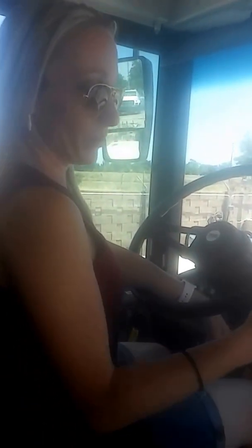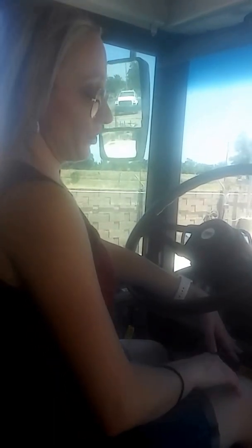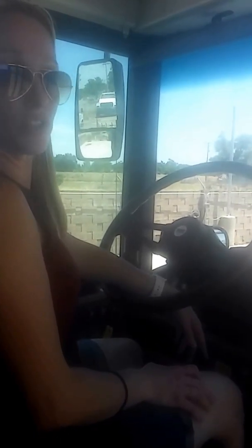Once I build it all the way up to 100, I'm going to go ahead and turn the bus off and turn it back on accessory, and I'm going to be draining my rear tank this time. And I'm going to be checking my emergency stopping system. Since I know that I can never stop with just front brakes, and I'm draining my rear tank, that's why it's the true emergency stopping system, because I have to have rear brakes.